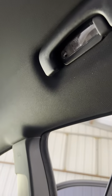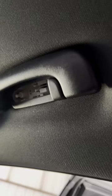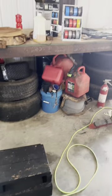So far, I think these are the easiest ones to install. I removed the whole little thing up there because I want to open up the case and see if I can change those other bulbs out, but these are less difficult. You just stick a little pry tool in the corner where the button is. I guess it's easier if you hold the handle down, but get in there, pry it out a little bit, and then the housing will fall right off. I've got this little pry tool here to just push the bulb out and change it. You don't need to remove the whole thing unless you want to take the covers off of these. There are some screws in there, but we're not doing that.